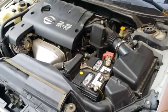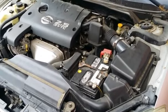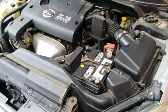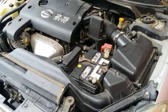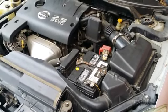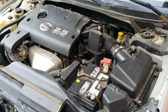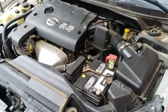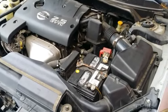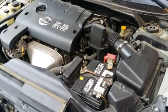Good morning YouTube, this is Cactus Naga and I'm here with my 2003 Nissan Altima. A couple of weeks ago — on Christmas Day actually — I was at Safeway in the parking lot and this car refused to crank, refused to start. I thought it was the battery and was looking around under the hood when a fella pulled up alongside and offered a jump. We connected the batteries and still there was no crank, which changed the focus to the starter. This good fella went back to his truck, brought out a hammer, started tapping on the starter, and the car started.